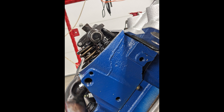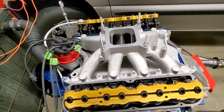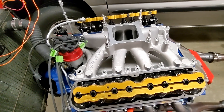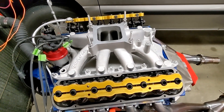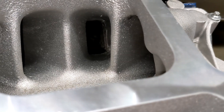The flanges from top to bottom are about an eighth inch taller compared to the Edelbrock RPM air gap, which effectively makes it wider and it wouldn't sit down between the cylinder heads. After I knocked a little bit off the top I still couldn't drop it down — I had to slide it in from the end and then take a measurement to see how far it had to be dropped to get good port alignment. So I had the ends milled about a hundred thousandths at the machine shop, and as you can see here it ended up with pretty good port alignment.